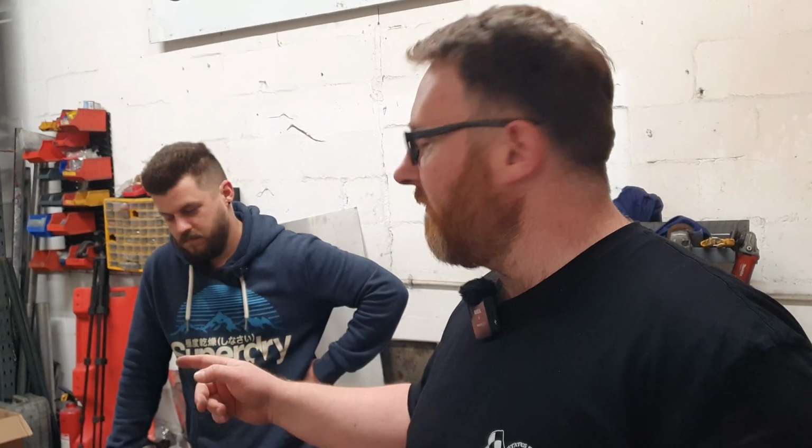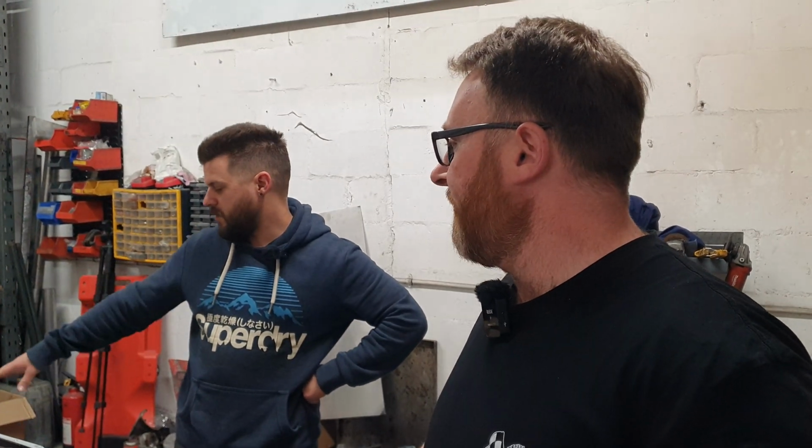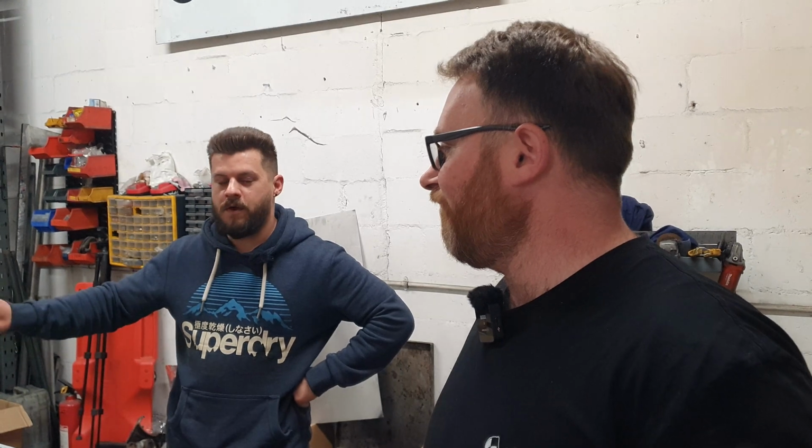It turns out that all of the electronic systems that run relays for an MX-5 of this generation, it doesn't put volts out to activate the relay. Takes volts in, if you know what I mean. Yeah, it grounds the relay, basically. Rather than, you have, from the fuse box, switched lives that power the low side of the relays. And then what the ECU does is it just grounds the other side of the relay. So needless to say, I had the opposite way around, and it was just a simple wiring swap of two things on that relay.